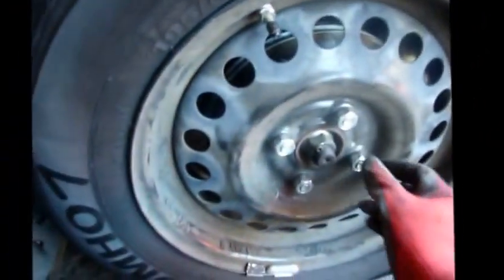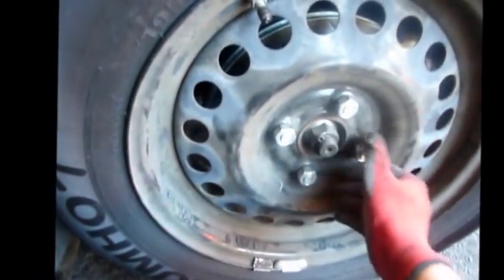Alright, once you loosen up the lug nuts, all four of them. Alright, when jacking up the car, you're going to do both sides at the same time. You want to center your jack. In this case, right below the transmission link, because that beam back there is a little bit too far away to reach with the jack. You can do one side at a time, then you just jack it up from either side of the vehicle.